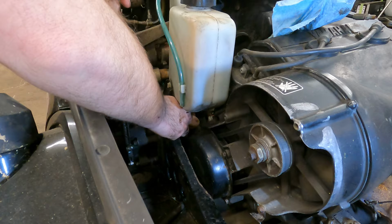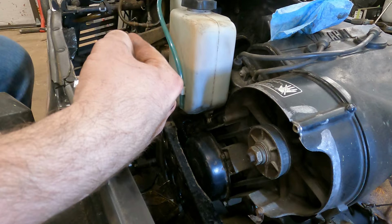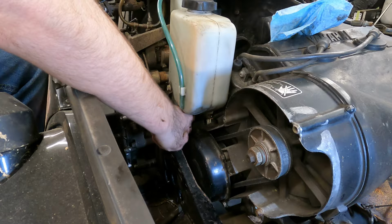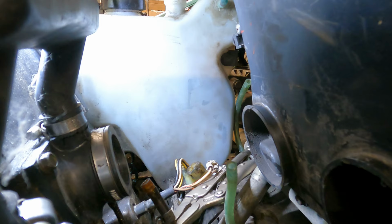So what I'm gonna do is I'm gonna pull some of this out, and then I'm just gonna tie a knot in it. Once there's a knot, then that'll free up everything that's up there. I'm gonna untie the knot in the handle. Actually, I'm just gonna cut the knot in the handle, and I'm gonna pull the rope through. So now the recoil rope isn't gonna bust our balls at all. I'm gonna unhook some wires down here. So the motor's electronics are all unhooked, except for the starter, which is buried way at the bottom.